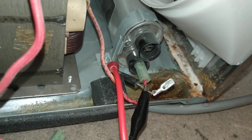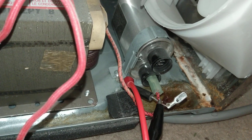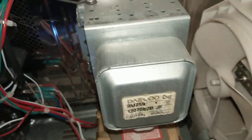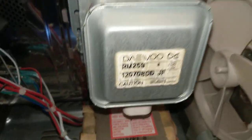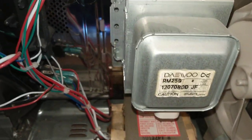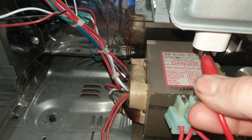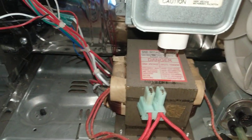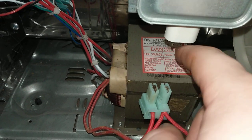That's it for this video — I'll make an update once the parts come in. Thanks for watching. Quick update: I went ahead and tested the magnetron and it passes, so that's good. The way you test these — set your meter to the lowest resistance setting, put one lead on one terminal, put the other lead on the other terminal. You should get under one ohm of a reading.